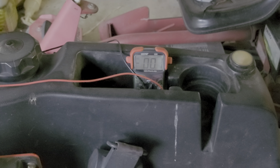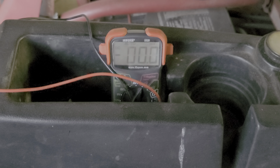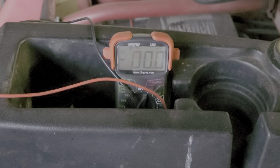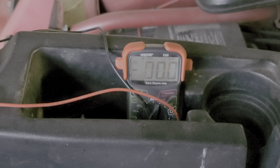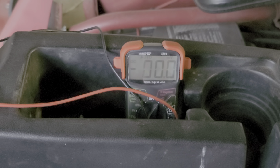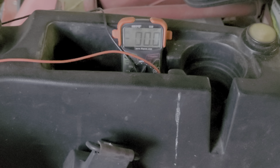All right, my battery on a 2009 S150X Snapper Zero Turn is not charging. This is the reading I get when I have the ignition off. The positive lead goes to the rectifier with a battery outside, and the negative lead goes to the wire that actually runs through the ignition system and goes to the battery to charge it. Obviously, the mower is not running.